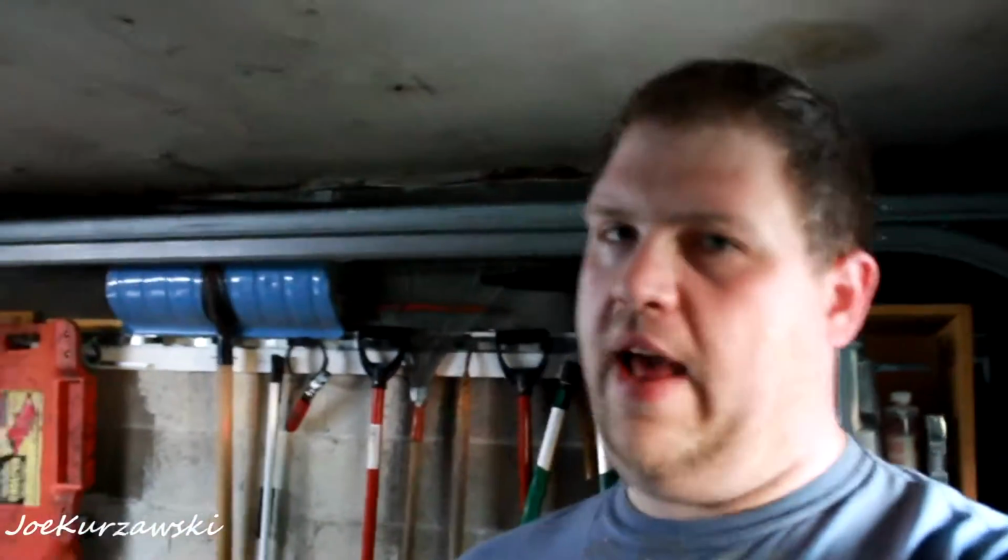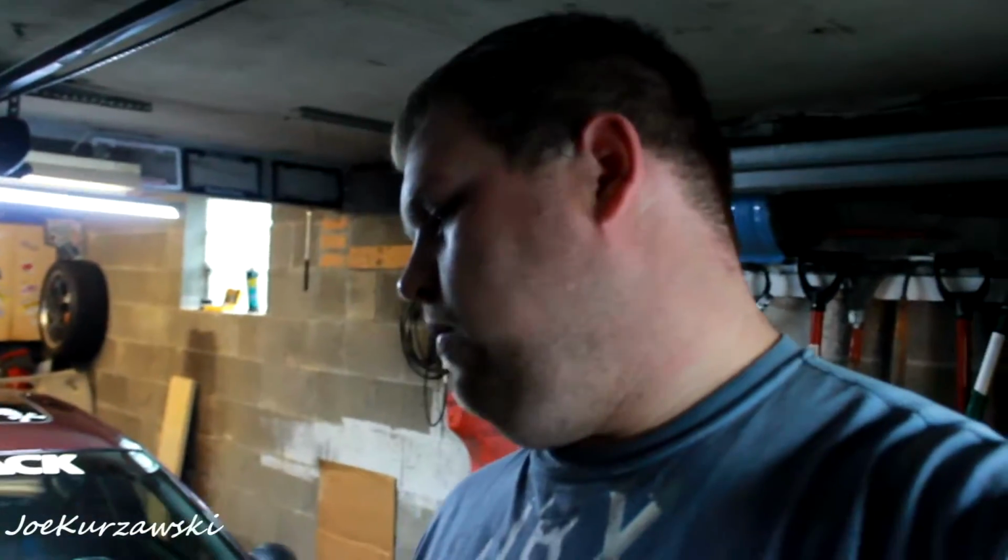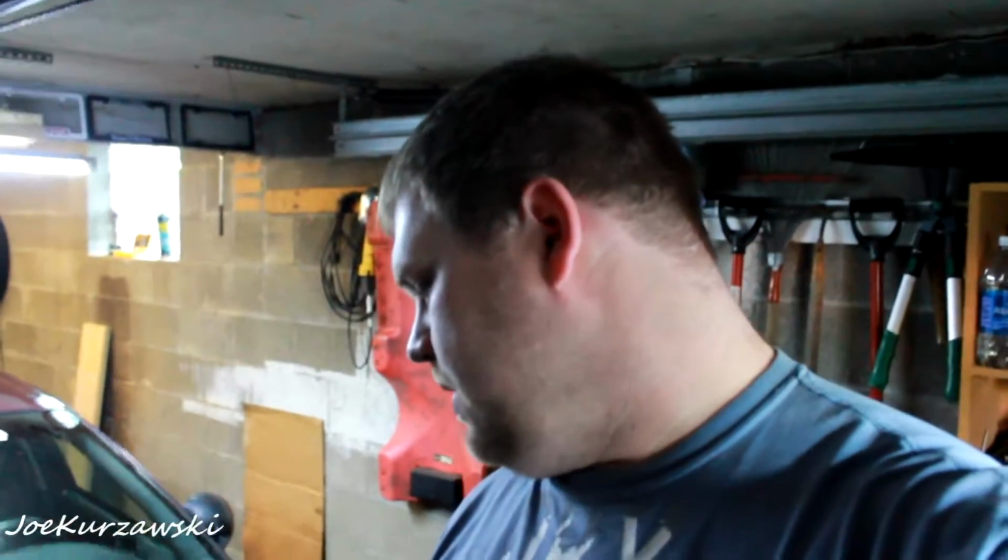So if you have a normal car, it's going to take 4.5. I think the 4 cylinders also take 4.5 quarts. Some places I see online say they take 5. The Haynes manual I have says it takes 4.5. So 4.5 for the engine, half for the oil cooler, and run it. If anything blows by, just keep an eye on my catch can.